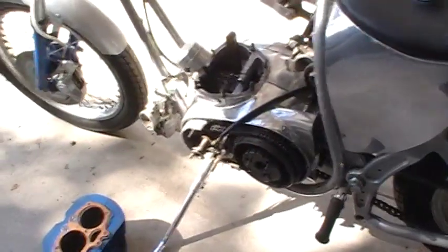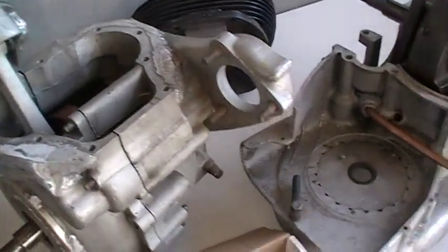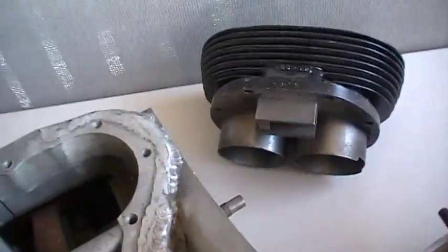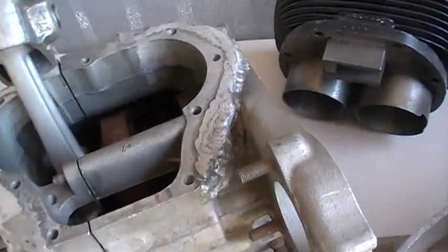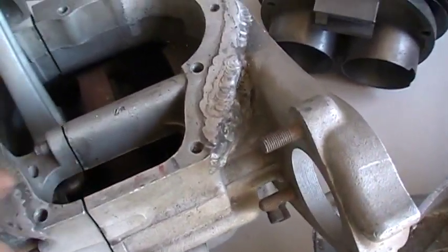This one's 833. This again will be the same as that. This will be a 900. But trying to make an A65 barrel go on an A10, modify the cams, I'm going to have to deck this almost right down to the bottom there to get some deck height, and to get the cams and the followers to work on the different height of the cam.